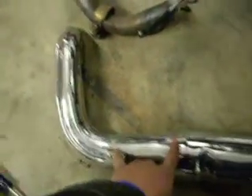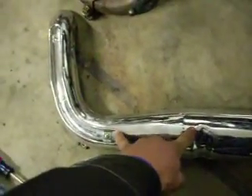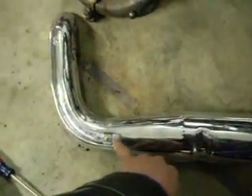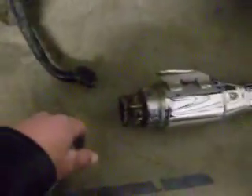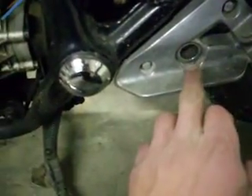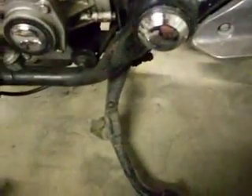Takes a little effort. You gotta move your heat shield — this one has three four-way screws: here, here, and on the back side. Real simple. Then this exhaust tip — same bolt — comes undone from there. Pre-muffler chamber comes undone from here. Real simple, easy to do.